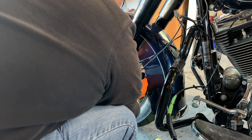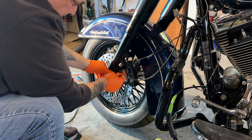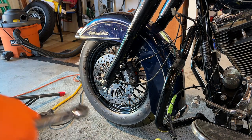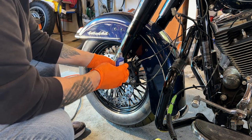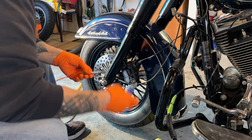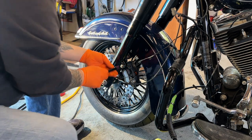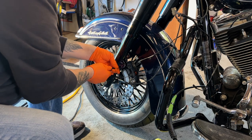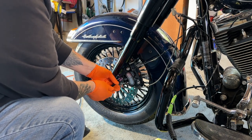Let's get this caliper on there — brakes in there and they fit perfect. I'm going to get the loctite and torque wrench. I love Frenchies — we got a new one, actually posted them on Facebook and YouTube. So I'm putting blue loctite on here and I'm going to torque these to 35 pounds. They go on pretty easy, you could just put them on there with your hand. Man, these calipers look pretty good after you go through them.